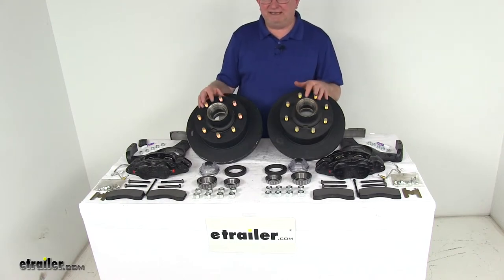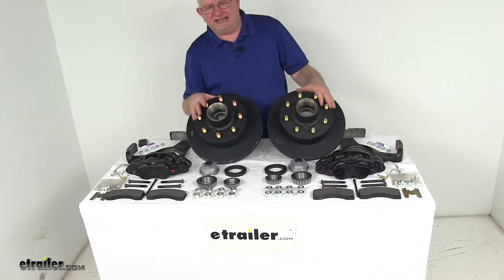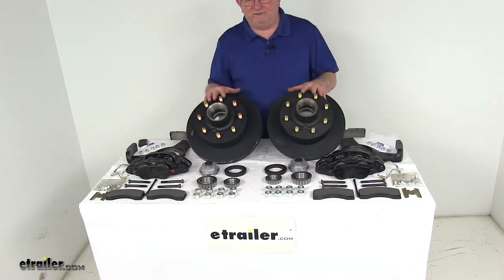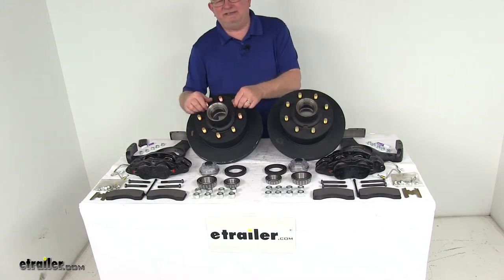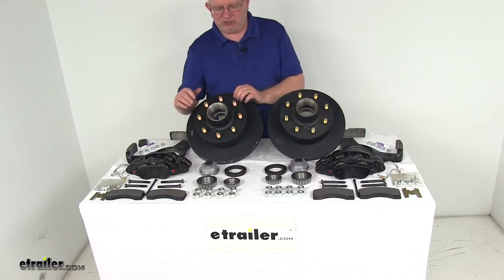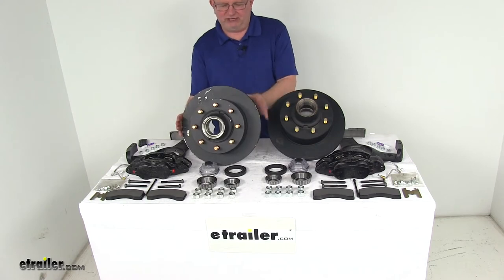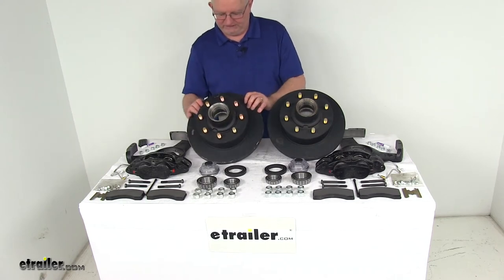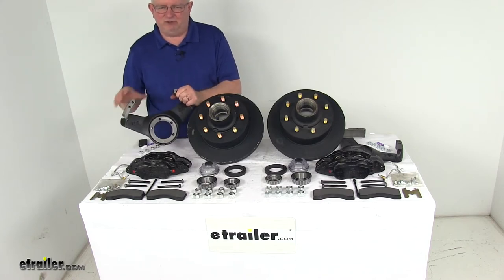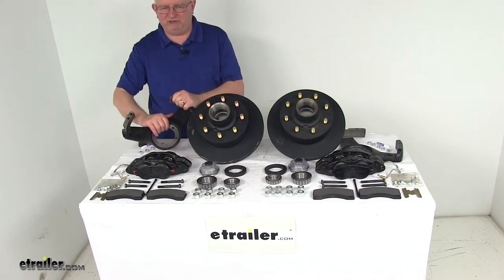These parts are made in the USA. This is designed to fit axles of 7,000 pound capacity. The wheel sizes that will fit are 16 inches, 16 and a half inches, and 17 inches in diameter. The bolt pattern is 8 on 6 and a half inches. The wheel bolt diameter is 9 sixteenths of an inch. The rotor diameter, measured edge to edge, is 12 and a quarter inches. The caliper mounting brackets use a 5 bolt brake flange configuration.